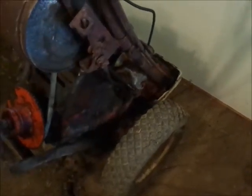And I see there's some Mickey Mousing going on with the linkage over here. This needs flipped down below, because when you engage it forward, you can see it pushes way down, and that's why that rod's bent weird. When you pull it back for reverse, it actually pulls it straight. So that's why it's flipped below like that, for anybody who ever wondered.